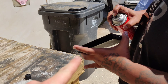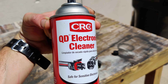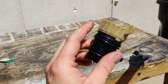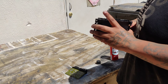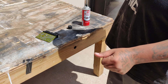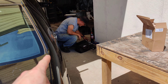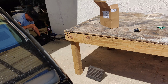Xavier is cleaning down the TCM with CRC electrical cleaner — this is stuff I use all the time, so make sure to pick this up. What causes the oil contamination is this little gasket right here. The oil leaks through the conductor plate and then travels up the wires into the TCM, shorting it out — that's what causes limp mode. Clean it down until it's completely clean and let it air dry; the CRC dries pretty quickly.